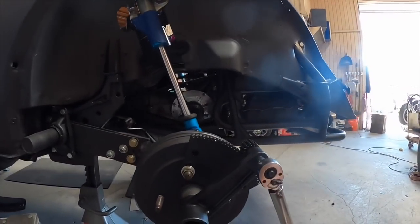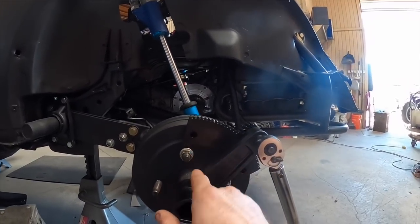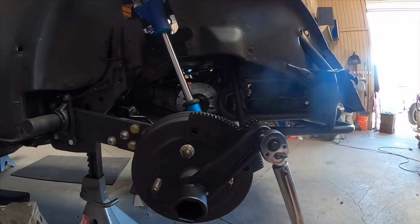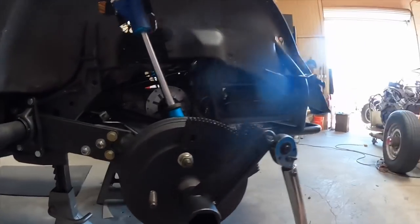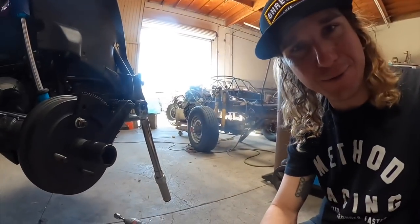This is a really cool part from MP, for working with either a wide five setup or even with the four-bolt Volkswagen stock pattern. Pretty trick that way — you know you're getting those things tight. I also have a big breaker bar that I'll probably put on it, but I thought this was pretty cool so I ordered one up. It works and it's accurate — I just checked it with a piece of pipe and my normal torque wrench on the other side.